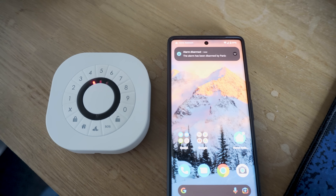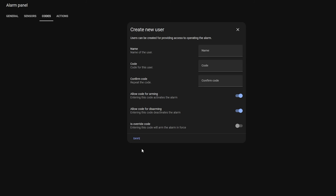The second automation is a panic or silent alarm. Picture a scenario where you are forced to disable the house alarm — you enter a specific code into the keypad which will seem like it disabled the alarm on the surface, but in the background it will automatically trigger a separate routine and maybe a silent notification to other family members to let them know someone is in trouble. This works whether you are using a physical keypad or the Alarmo keypad on a tablet or mobile dashboard. Simply head over to Alarmo and create a new user with a new code. You may want to use a fake name or alias instead of 'panic' because you don't want your speaker to suddenly read out the word panic and tip them off.